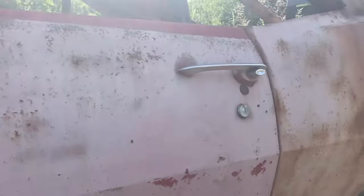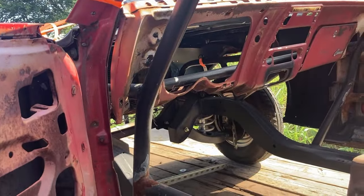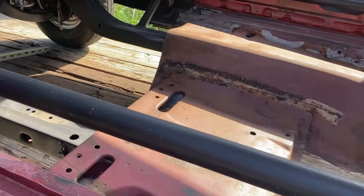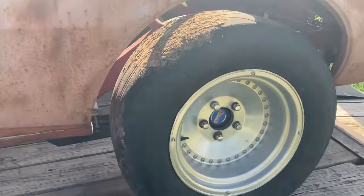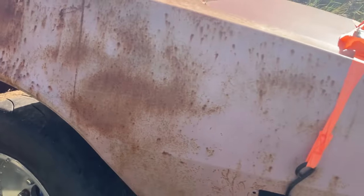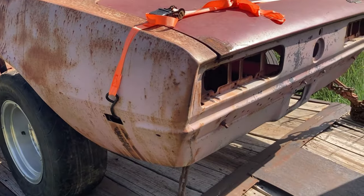It is on the original frame, but they've welded tubes in it. The doors still unlatch quite well, but it's got no firewall, kick panel, or floor pans except for where the seats go — all the rest is gone. It's got a Quick Performance nine-inch rear in it with a roll cage. It was a drag car that somebody lost interest in, or money, or whatever.